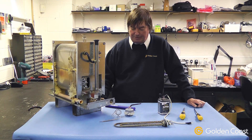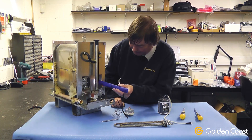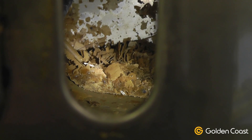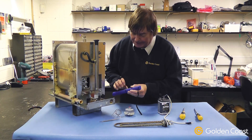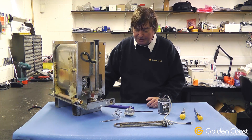As you can see, this one hasn't been terribly well maintained, and if we look inside the tank where I've taken an element out, you'll see there's a large build-up of limescale at the back already. That would probably take two or three flushes of a proprietary cleaner to get rid of that scale.